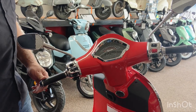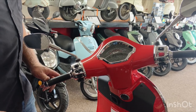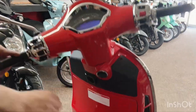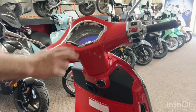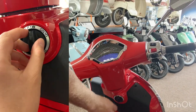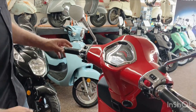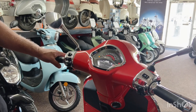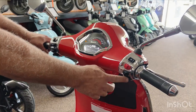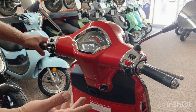When your key is in proximity and paired to the scooter, all you have to do is push the ignition switch in. You'll see it say 'Welcome' on the dash, at that point you turn the switch all the way to the right to turn it on and the scooter's ready to ride. To start it, squeeze one of the brakes and push the start button.